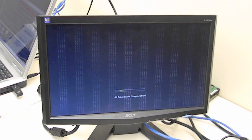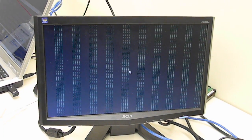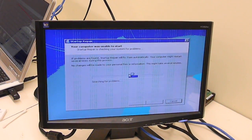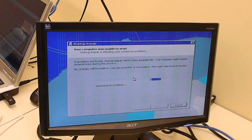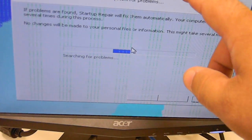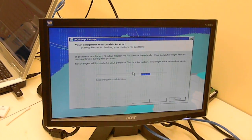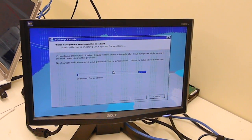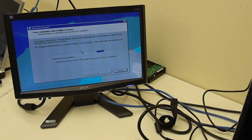So when this system will actually come up, it'll process the display in 8-bit colors. So you have 8-bit background and fractured or artifacting lines going across the screen right here. So we'll take this laptop apart, reflow it, and in maybe 30-45 minutes it'll actually show a picture on the screen. We'll get back to it then.